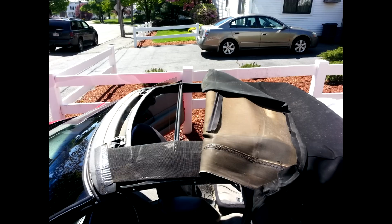Here's another shot of the top section being peeled away. As you can tell, the headliner has been dropped off the first two bows to get access. You're going to peel these little strips of cloth off the bows from the top. As you can probably see in the very center of the picture, you can see the cloth strip. It's just glued on, so you just have to peel that back. And as you can tell, the top definitely was due for a replacement. The edges where the cables ran down, it separated from the top, and it had some holes in it and mildew, and God knows what else growing on it. For 18 years old, I think it served its purpose.